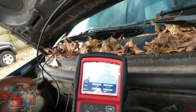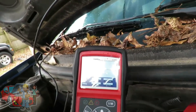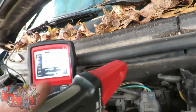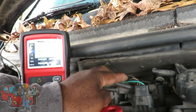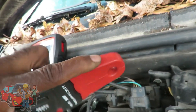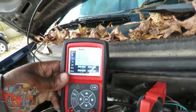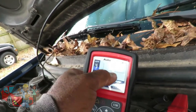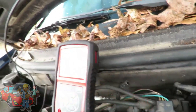A lot of you are probably saying, how do we know that's showing six cylinders and not two? I'm going to answer that. Let's take our current probe off, zero it out again. This time we're going to grab one of the wires going to two cylinders — and this time the arrow is going to be pointing toward the coil. Look at that — you see the spacing now? Two cylinders. It's showing me two cylinders.